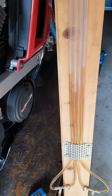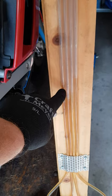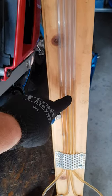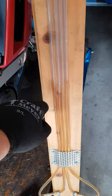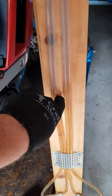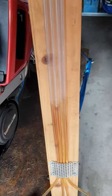So we see in this case cylinder four is pulling a bit more and cylinder one is pulling a bit more. They're not that far out as a whole set, but I would like to bring four down and three up and one down and two up to bring that into more of a straight line. So I will start by adjusting this pair, so you should see something moving, then I'll adjust this pair, and then we'll take it from there.